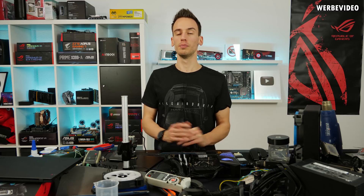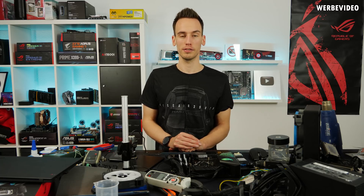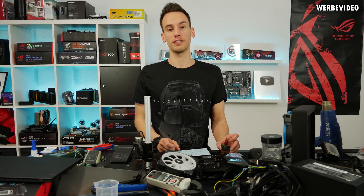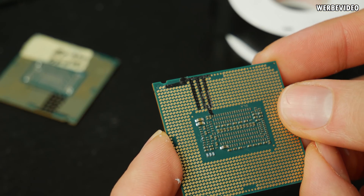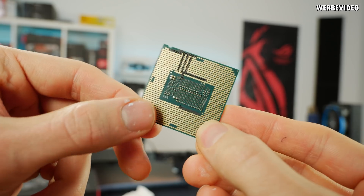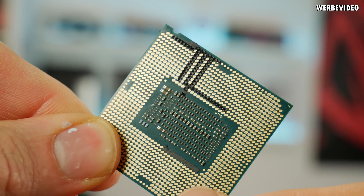The setup ran overnight and, as expected, no issues to the socket and nothing happened to the CPU — only 10% higher load per pin, similar to a 10% overclock. So I kept taping more pins to see how far we could push it. After almost a full day of testing I taped 18 pins, then 28, then 38, 45, 56, and finally 69 pins out of 146. The CPU still looks fine with 69 pins taped.